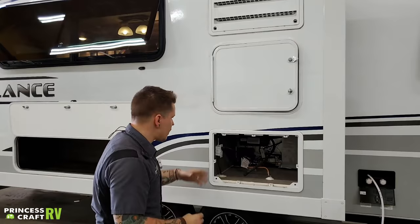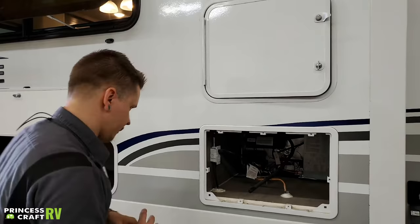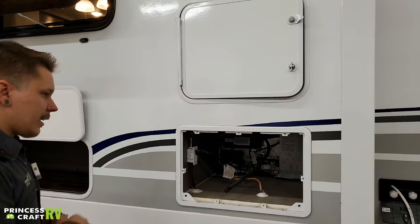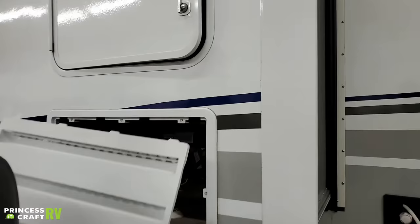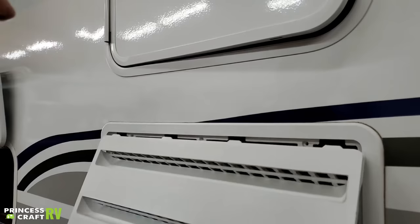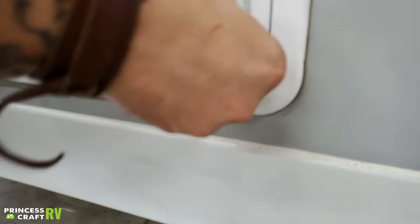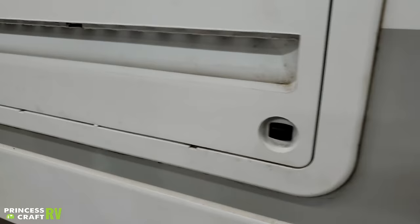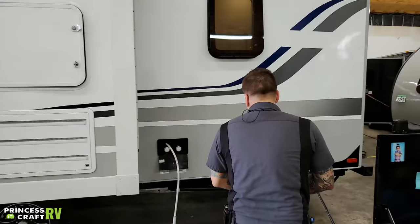My recommendation is to remove the vent cover here, get a flashlight, stick your head in there, make sure nothing has gotten in, make sure those wires are still in decent shape — no fraying or anything. Do that a couple times a year, keep the mud daubers and flying insects out, and that appliance is going to last you a long time. The vent cover will be in place when using the unit — these are easily removable. The tabs insert from the top. Once seated properly, you have two holes to line up, and once seated flush, give it a quarter turn to lock. A lot of people lose these because they're not installed properly, so keep that in mind.